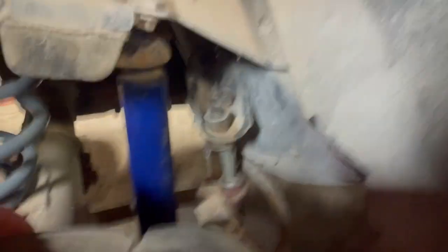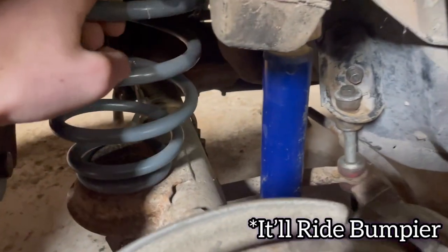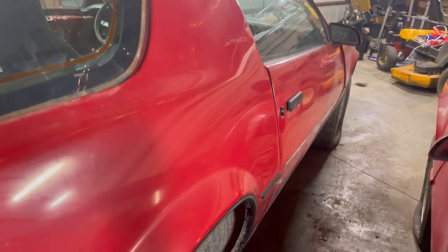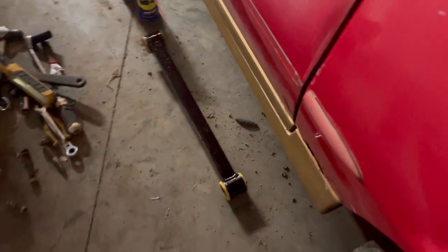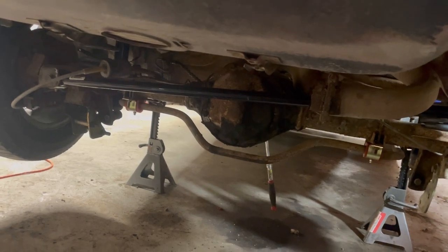Those are the shocks that we put on it. We painted the springs — these are the springs off a Z28, so it won't ride as bumpy. Put some new sway bar bushings on it. The car originally didn't even have a sway bar on it when we took the rear end out. So we put one on it because apparently these Berlinetta cars didn't come with that. We also got the lower control arm painted up. It's a posi-track rear end with a 2.77 rear gear — kind of not what we wanted, but there it is.